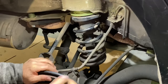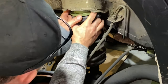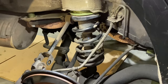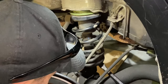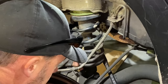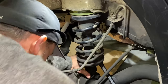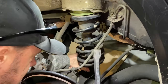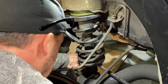Basically you just want to get the bolts lined up. Once you've got the strut in position, you're going to want to put the bottom bolt back in — a little easier said than done. You just want to use your pry bar to maneuver it around into position. This would be easier with a bigger bar but I lost my big pry bar, so now all I have is this little one.